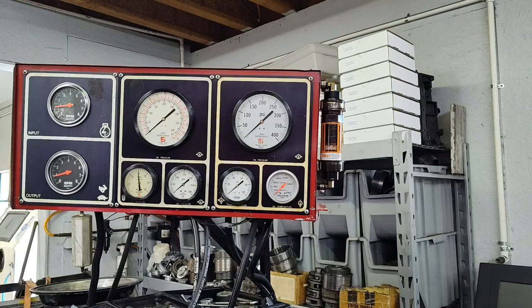So I hope that kind of clears this up. I skipped second gear because we went into it with the kickdown on, and when I pulled the throttle back it was ready to go into third, so it just stroked both shift valves once that kickdown oil went away. Totally expected that. But you can see the pressure is really no different with that kickdown lever - it affects the shifting but it doesn't affect the line pressure, and you can see it in the circuit.